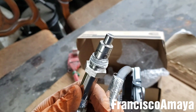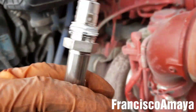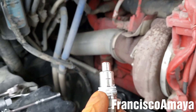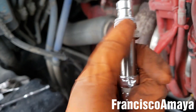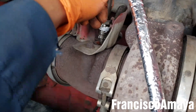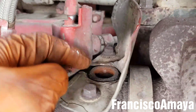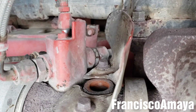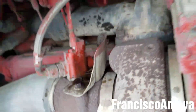The new sensor comes with a probe. There are some remanufactured sensors, but I don't recommend buying those — just buy brand new. The price difference isn't that much. This one is easier to install because the probe rotates separately, so you don't have to rotate the whole sensor. If you want, use a brush to clean the mounting area so it's completely clean. I'll also apply some WD-40 to clean a little more.